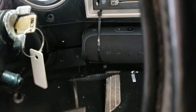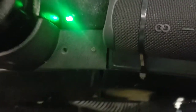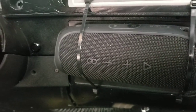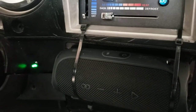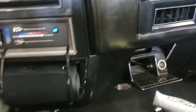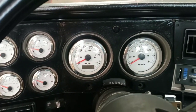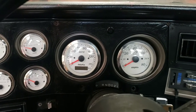If all goes well, I should be able to start this truck and that light won't come on until it gets vacuum. When I hit the brake pedal it goes out like it should, and if I turn my switch off it goes out like it should. So there you have it — that should work nicely. I haven't driven it around yet; I'm going to take it down the road and see what it does, see if I have to make any adjustments. It should be a good fix for my torque converter unlocking when I need it to. Like everything, it will probably take a few final adjustments, but that's the short and long of it. Y'all be good, thanks for watching.